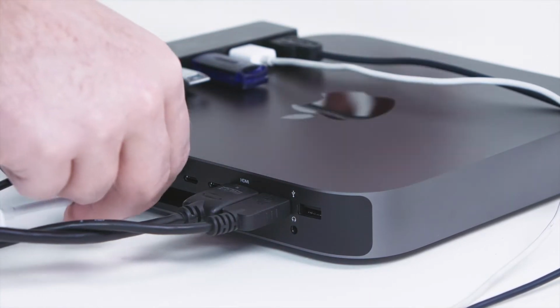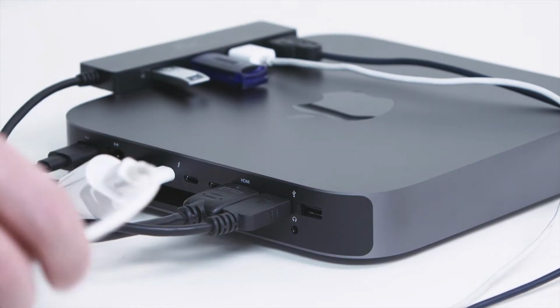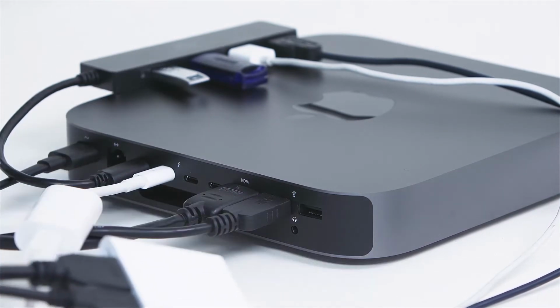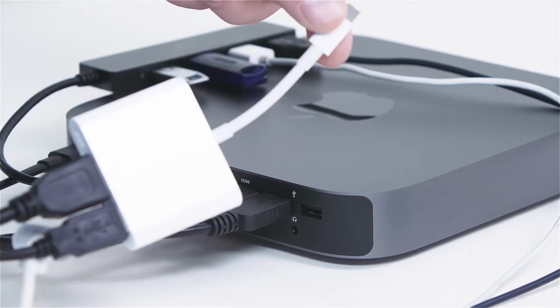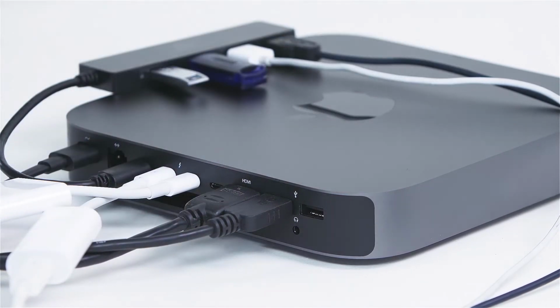If users have a Thunderbolt 2 interface, they will need to use a Thunderbolt 2 to 3 adapter to connect the interface. If using dual Ravens, users will need to buy an Apple multi-port adapter. Plug the HDMI and USB from the second Raven into the multi-port adapter, and then plug the adapter into a free Thunderbolt 3 port of the computer.